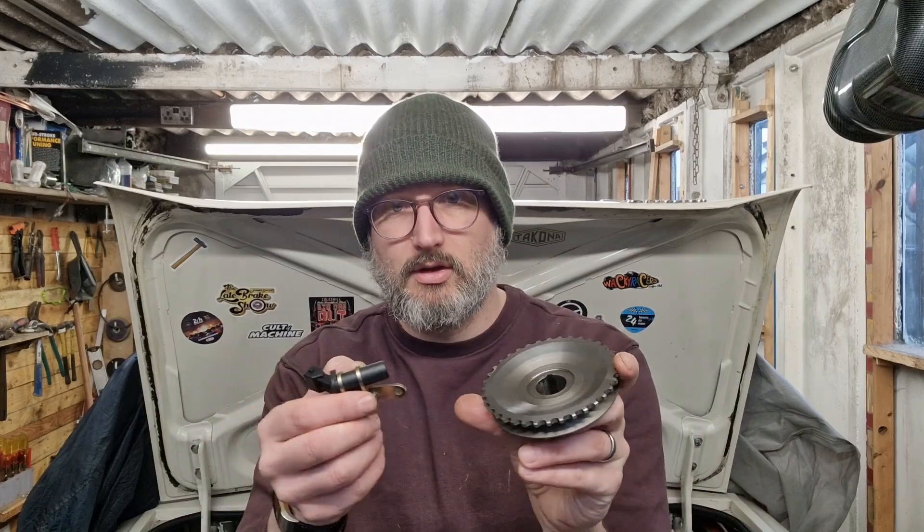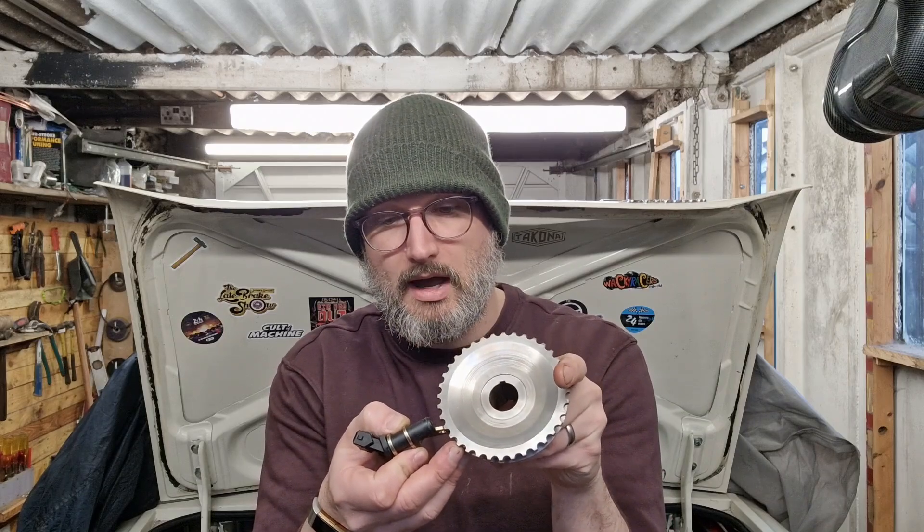Fortunately, the keyway on the pulley corresponds to top dead centre, so that's a good reference point. I've also got the DTI gauge to confirm TDC. I'm going to set it to TDC by turning the engine clockwise, then turn it anti-clockwise as a cross-check to account for lash in the drivetrain. Once I'm confident TDC is exactly right on cylinder number one, I need to mark which tooth the sensor is pointing to at that moment.